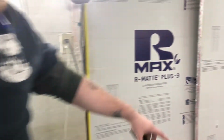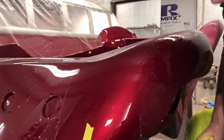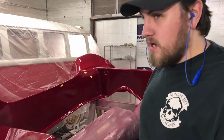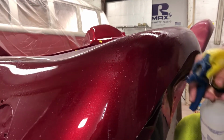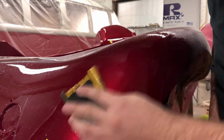I'll have you come over here because I got a dark spot. This is the 1500 soft block because fiberglass isn't exactly all the way straight. Oh, that's what this body is. So if it's metal, you can kind of get a straighter block. All right. But 1500, make sure the panel's wet. You kind of just do a crisscross pattern.